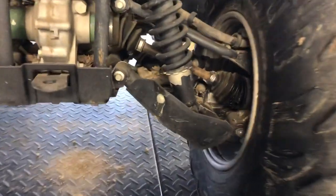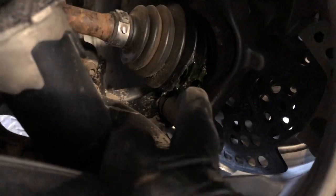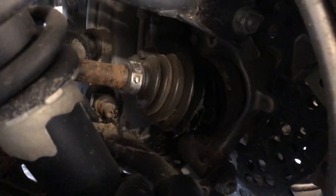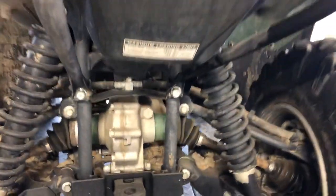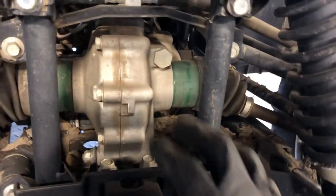We've got the right hand wheel here — these are an 8 by 12 inch rim. You can see here on this CV boot what I'm talking about: that's got a rip in it and we need to replace that boot immediately. We've got your tail light on the back here, and it's also going to be your brake light — that hooks up to your brake pedal.